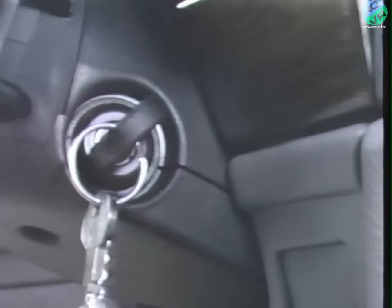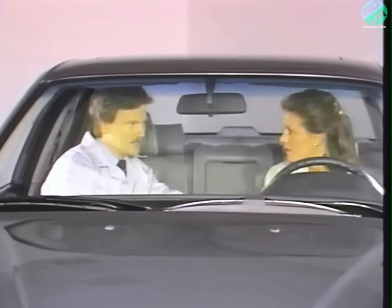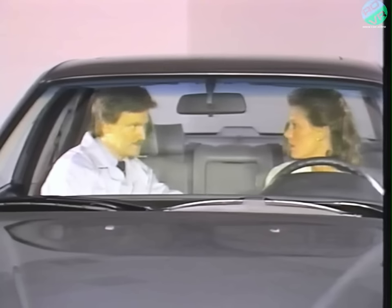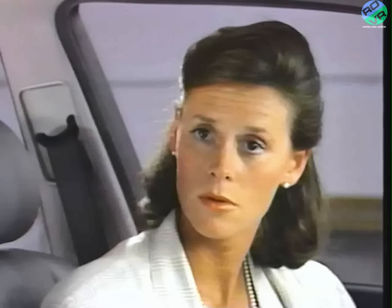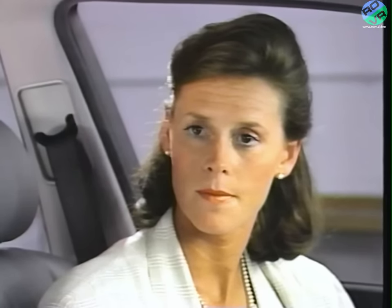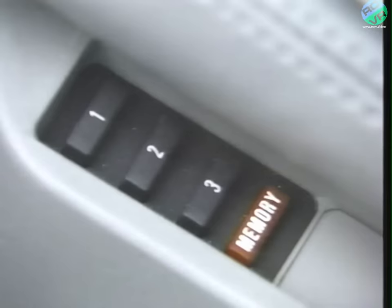If you want to recall your preset seat and mirror positions, there are a couple of ways. First, when you open the driver's door, press one, and the seats and mirrors will go to the memorized position. If you get into the car and close the door, you can start the automatic memory while the delay circuit keeps the interior lights on. If you miss it, you can either hold your number one or just put the ignition key in position one and press your number. There's a safety feature that doesn't allow you to turn on the memory circuit accidentally while you're driving. If you haven't hit the preset number button before you begin driving, you can still adjust automatically by holding down your preset memory number until the full adjustment is made. If you want to stop at any point, press any of the mirror or seat buttons or even the memory button.